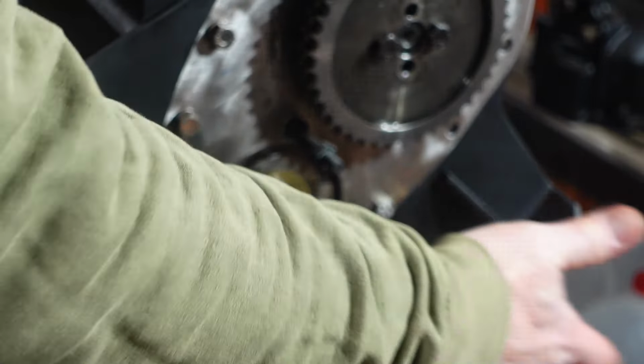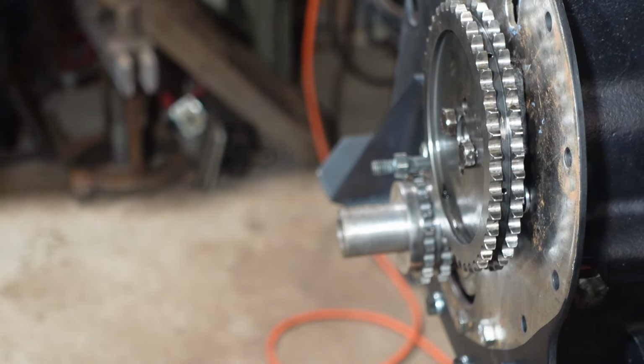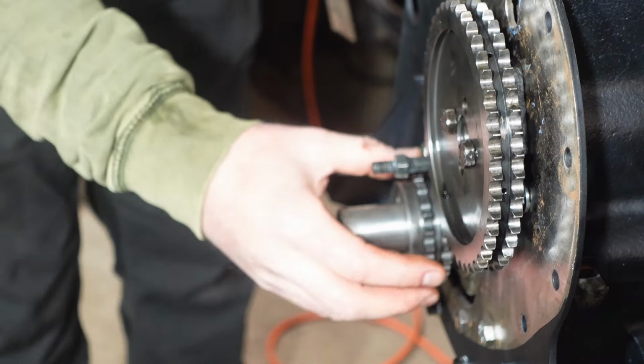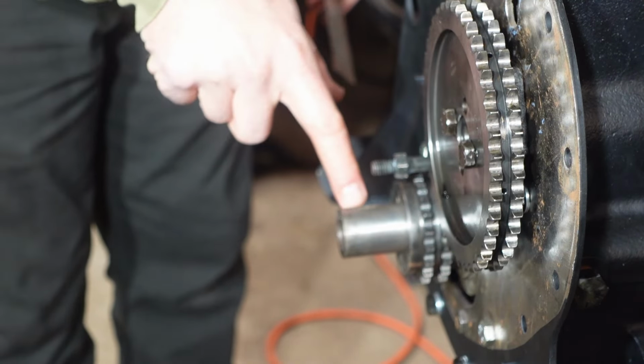And all I'm doing is putting the straight edge up there and trying to rock it. As long as I don't get any rocking, I think I'm fine. So that should be good with the three. And like I said, this is what came off. I didn't really change anything. Well, the camshaft changed, but I wouldn't expect that to really impact it too much. So now I'll pull that gear back off, and now I've got to put the Woodruff pins in there so that it stays positioned.